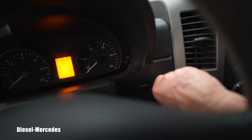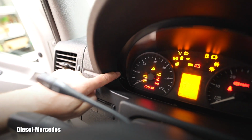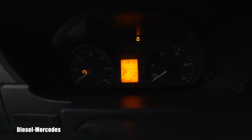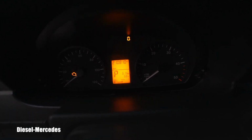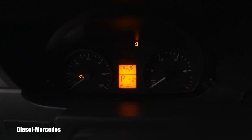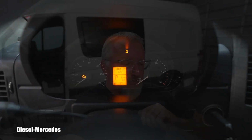So, ignition on, scroll to the oil, and we are right there, it's flashing, so it's measuring. Let's see if it will catch the fact we drained some. Oh, it's okay, so it's not saying it's low right now. Okay, cool, good to know. Which confirms to me that anywhere between those lines, the very high and very low, it will keep reading okay. When you start dropping below it, it will go -1, -1.5, or -2/4. Okay, cool. I will talk to you tomorrow.